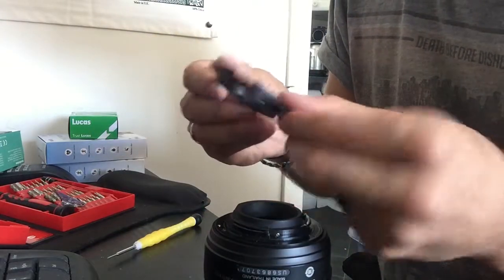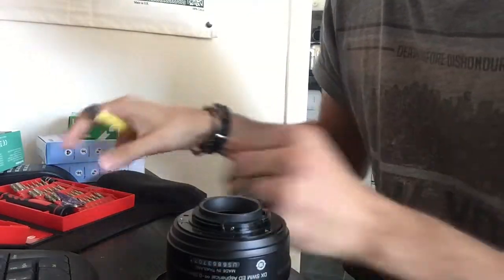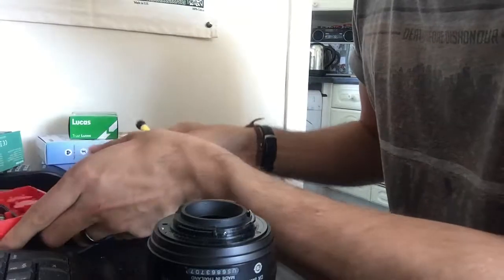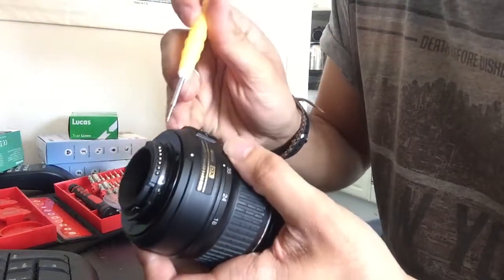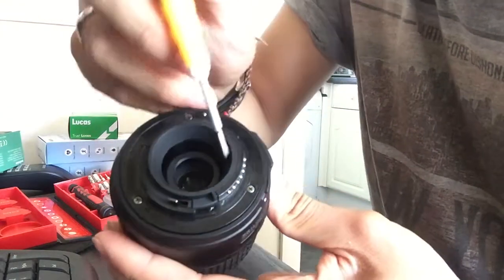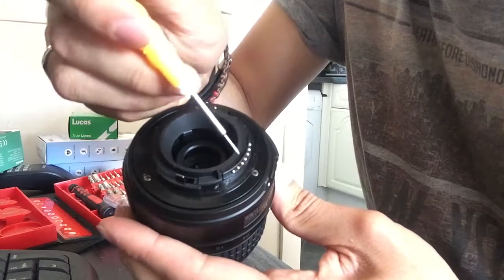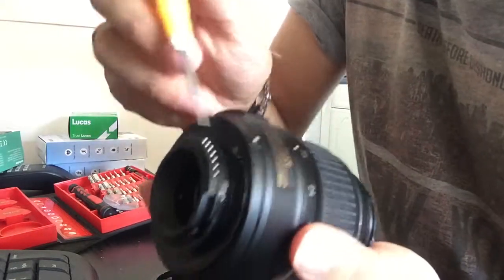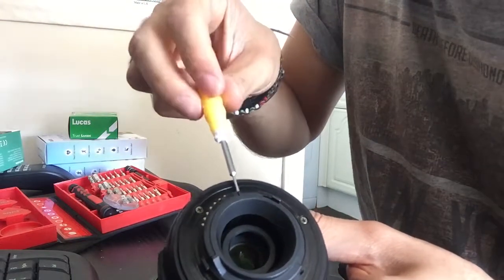That's going to replace the ring there. So we'll start — I've got a small screwdriver and I'm using my dish from the hand tool kit as a holder for the screws. What you'll notice when unscrewing — something I didn't really show in the last video — is you've got two screws here, then three which hold the retainer clip, and then two for the connector. The two on the connector piece are slightly different in the way the screws look. I'll first get rid of the three screws which hold the retainer clip.